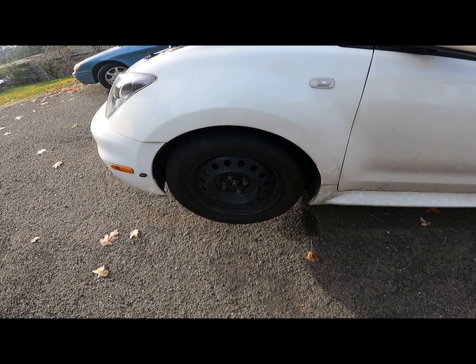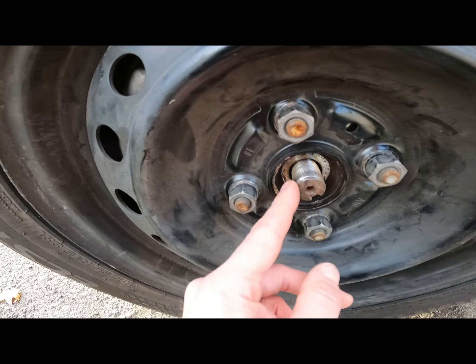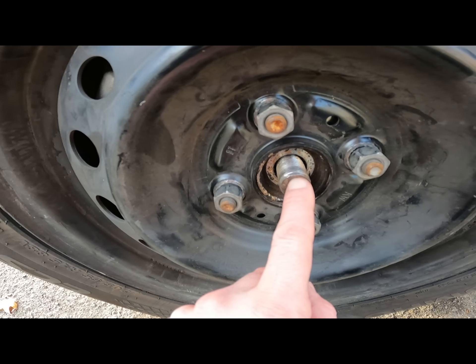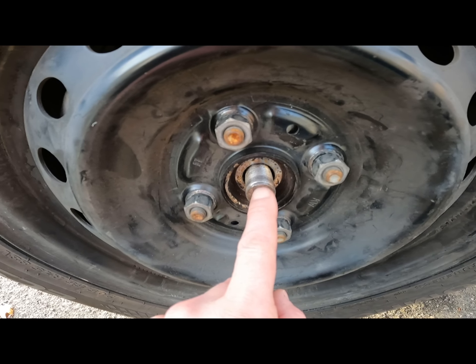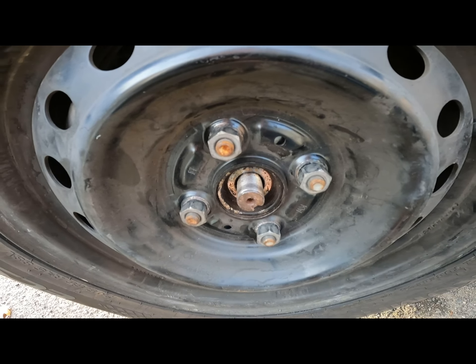The other difficult issue is that I forgot to put a nut on here when we banged on it, and it messed up all the threads on the axle, so I can't get a nut on there. I ordered a new die so I can recut those threads, hopefully save it, then get a new nut on there and tighten it properly.